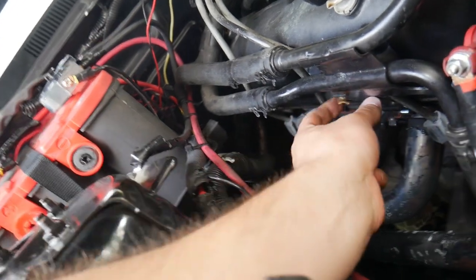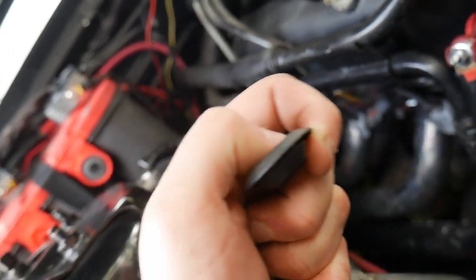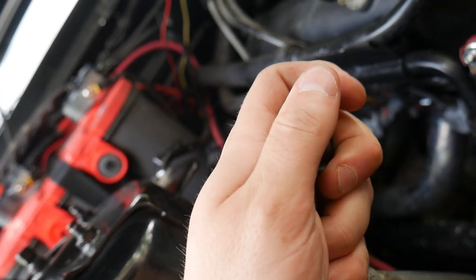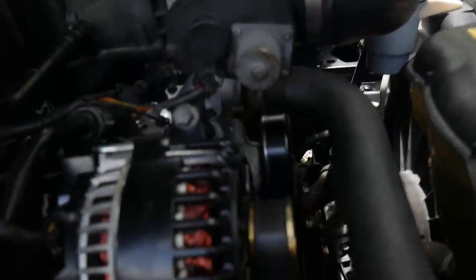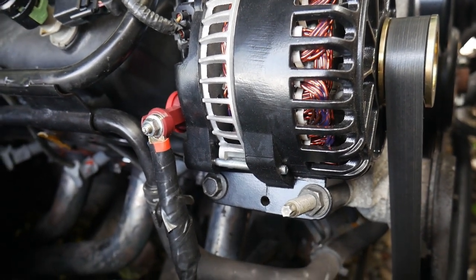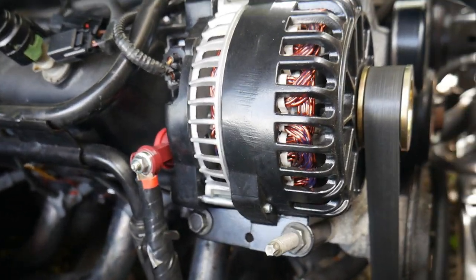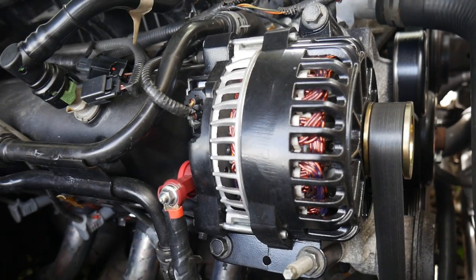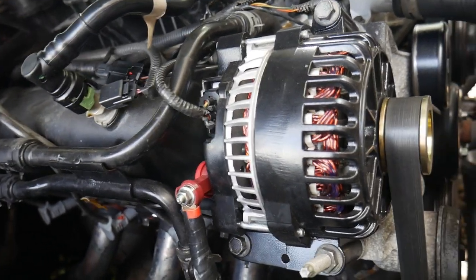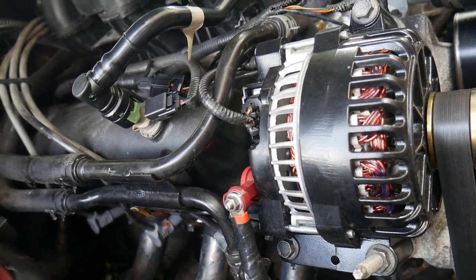We actually got to put this process on hold for just right now. I thought I had four gauge wiring to run for the amp — that's what I used because this system was in my Explorer and I thought I was running four gauge, but it turns out it was actually eight gauge wiring for the amp. It's recommended that you should at least have four gauge or lower, since lower gauge is thicker.